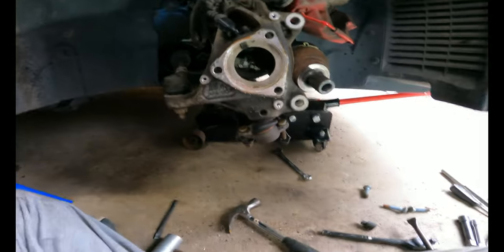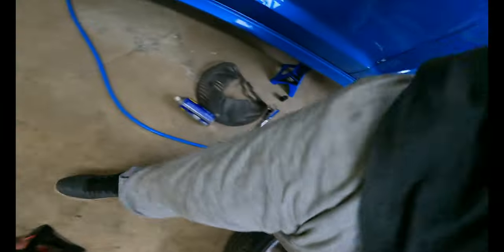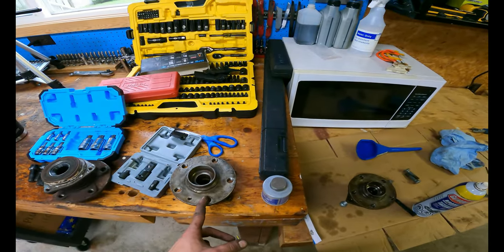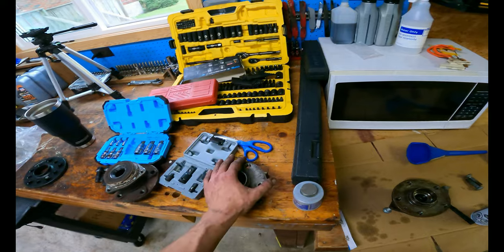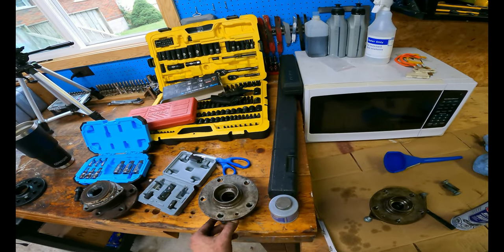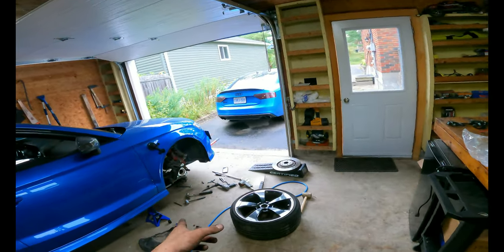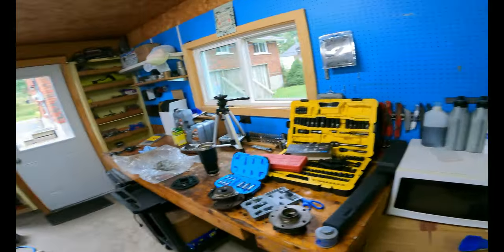And yeah, we'll throw the new one in. I got a new used one, so don't criticize me after we use my axle bolt. So FYI, the RS3 wheel bearing is slightly taller than the S3 and the TTRS. They are only made for the RS3 for 2 years, and they're $2,200 from Audi, and through FCP Euro, I think it is, it's 650 something US. So that's like $1,000 Canadian.